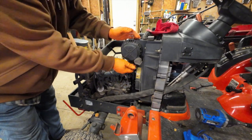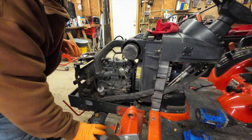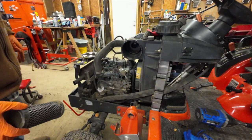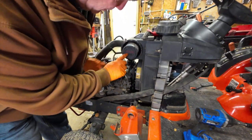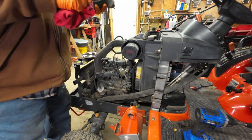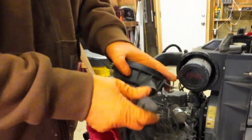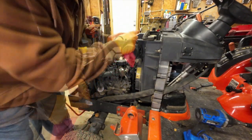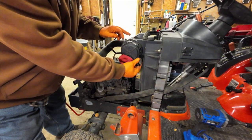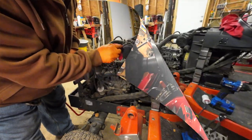All right, so here's the air box. I'm going to take and remove the cover. Good and dirty — you can see it needs cleaning bad. So we're going to go ahead and throw that away and install the new one. I went and wrote 1222 on there for the 12th month and the 2022. Do you see all that stuff that fell out of there? On the air box there's an arrow up here on top. It shows where the catch goes, and then I put it that way — top goes down. Just follow those.